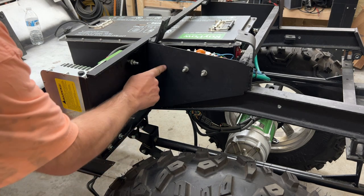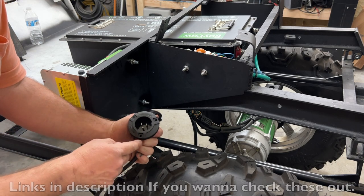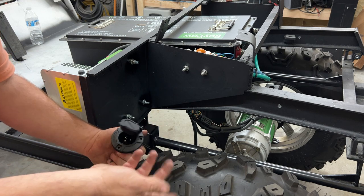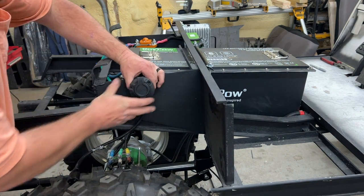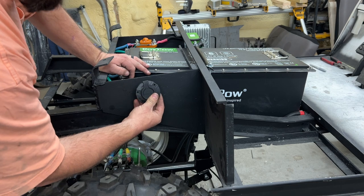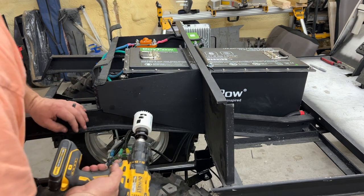The microphone just died so I hope you can hear me okay. I need to drill a hole here — it needs to be a two-inch hole for the NOCO. Basically it's a waterproof connection — an extension cord that plugs directly in here — and your charger plugs directly into it. People use these on automobiles and all kinds of things. After thinking about it, I could do it right here in the middle and gain access straight through the tire well, so I won't have to reach at a bad angle when getting off the golf cart at night.